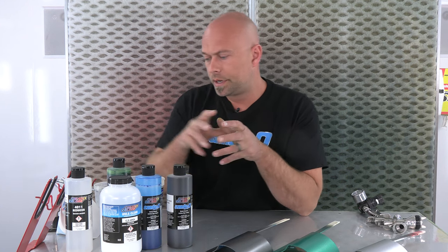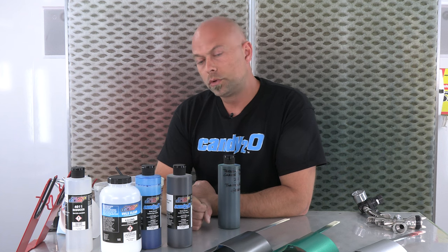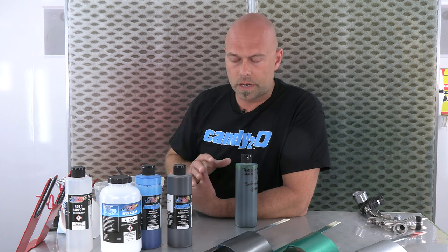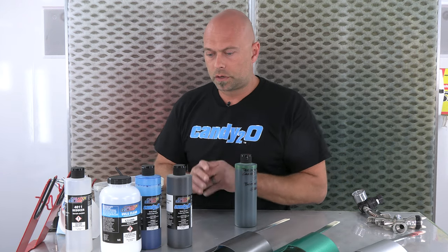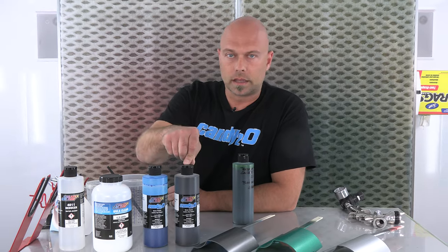So our British racing green that we're doing today, I already have in the bottle — it's kind of a blend. Rather than starting with the emerald green and trying to adjust that color, I opted to go in a different direction. I really talk about making the mix easy, consistent, and repeatable — for consistency, and being able to make a small amount or a large amount. Sometimes having a multitude of candies that you have to mix, with one and a half percent ratios, it just kind of throws that ratio off. So rather than starting with emerald green, I'm starting with our carib blue and our tequila yellow.